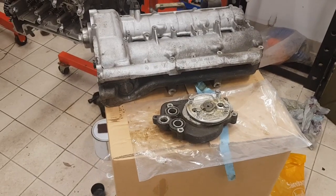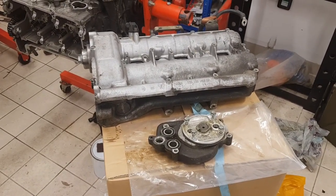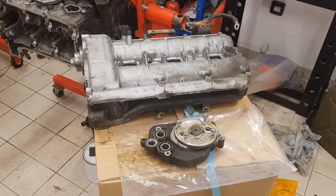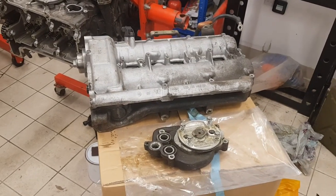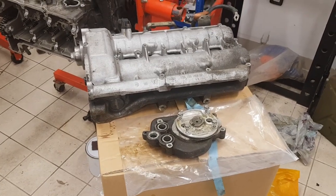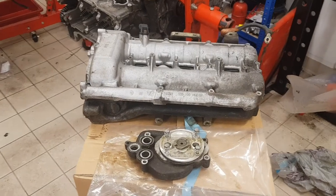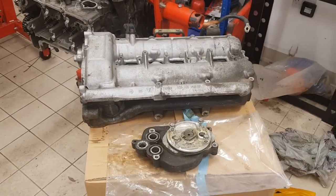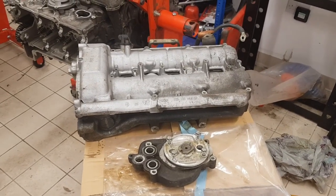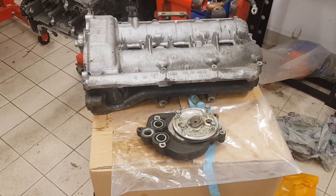There's what's known as the Mezger engine, as fitted to the GT3s, Turbos and GT2, and the non-Mezger engine which is a Carrera engine fitted to the Carreras, C4s and the Boxsters and Caymans. These scavenge pumps are designed to take air and oil from the cylinder heads and return them to the sump. On the earlier air-cooled engines they used tubes to return to the sump, but on the later engines they moved to a more active system for getting the oil back.